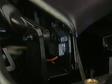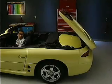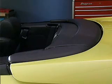The ECU monitors hardtop location through another position sensor, located on the hardtop main pivot. After the hardtop is fully stowed, the tonneau closes and is mechanically pulled to the latched position by cables attached to the tonneau lift mechanisms.